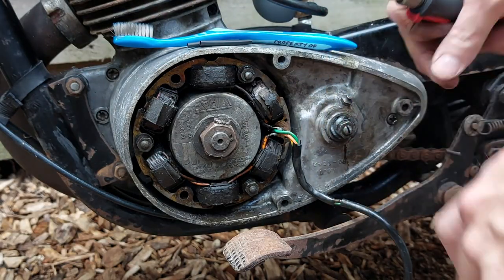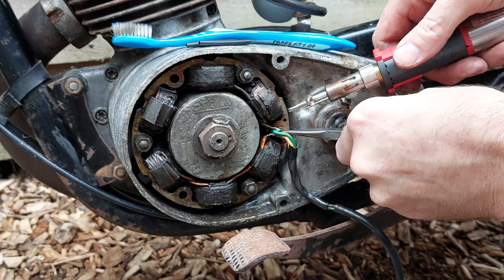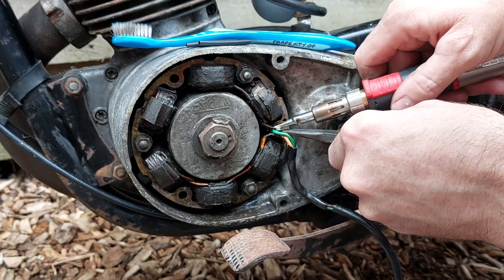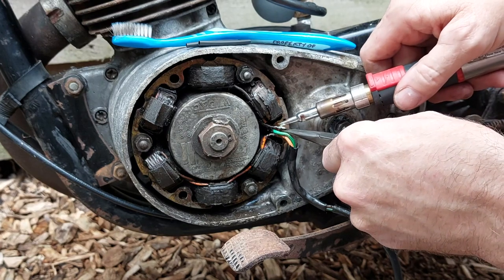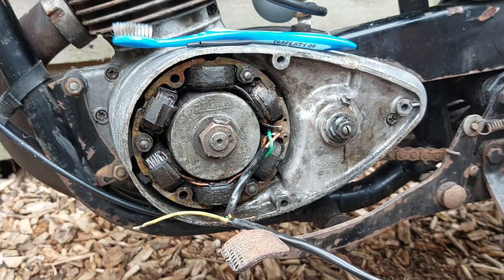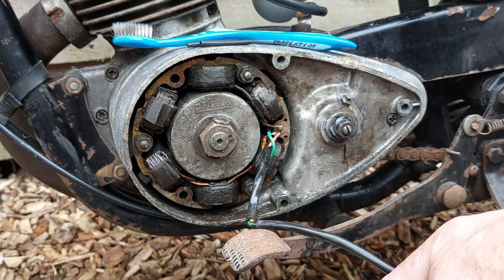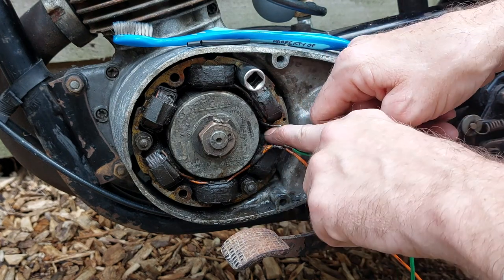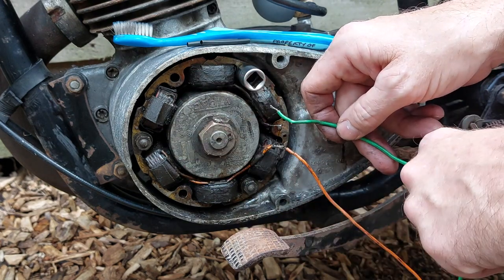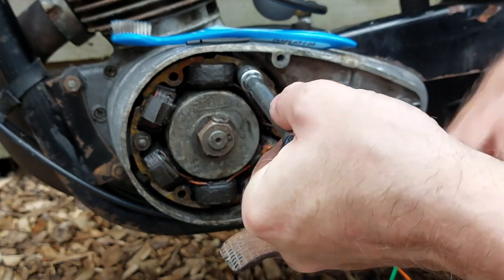See if we can put a new one in there. I'll give that a bit of a clean first. Right, see if we get the yellow wire out. Okay, unfortunately the green wire's broken off and that's wired down inside there. So I'm going to have to take the windings off and rewire it on the bench. Another 5 minute job. Taking 10 hours.